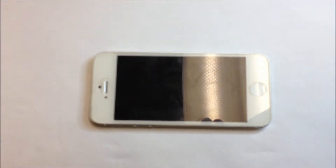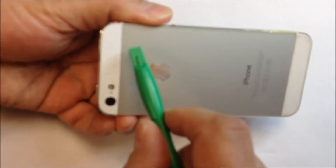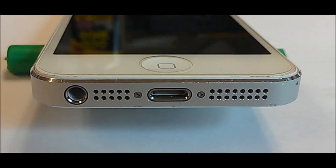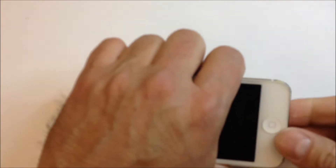You want to be careful of the flex cables inside the phone behind the lens — they actually plug in down here. At the bottom we're going to start with two pentalobe screws, one on either side of the charging port, just like the ones used on the iPhone 4. So we'll start by removing those two.